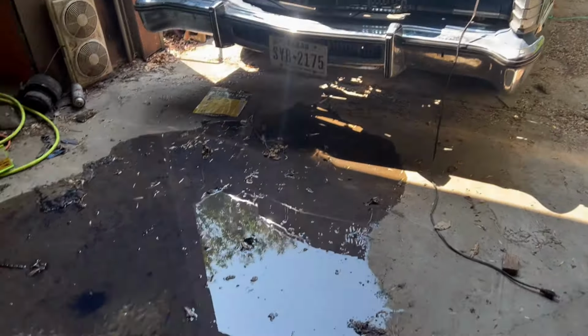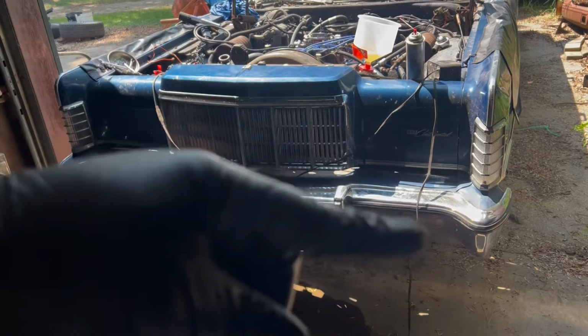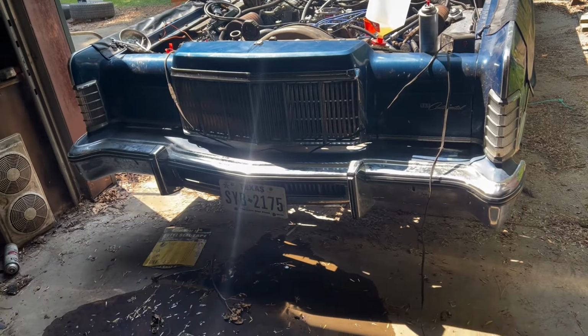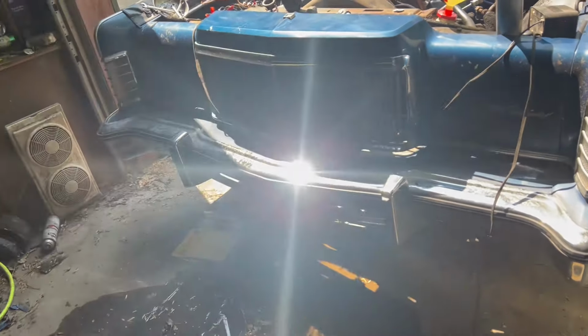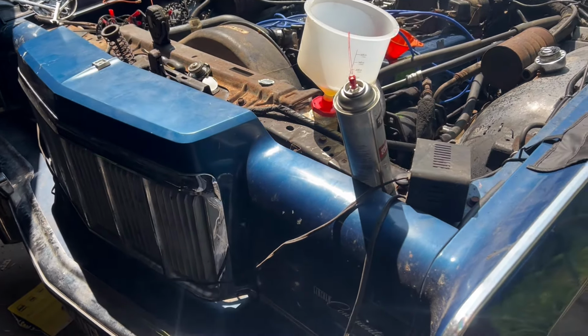So that's got to be what happened. And like I said, I saw the oil pressure gauge go way up, and then it went back down, and that's when the oil filter blew. So I cut it off real quick, but it was sailing up there. That gauge goes up to, I think, 300 psi, and it was heading that way before the oil filter blew. And I had that oil filter on tight, and it blew the gasket out twice. So yeah, I definitely have an oil pressure regulator stuck on the oil pump. It's got to be what it is.